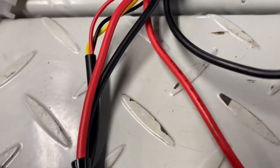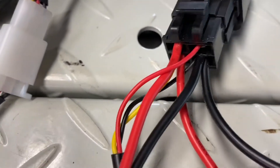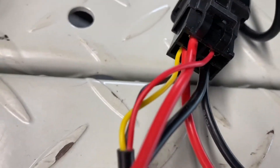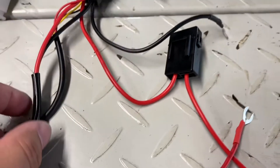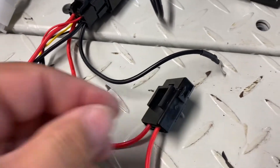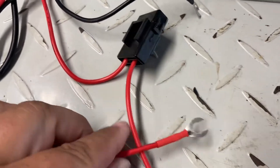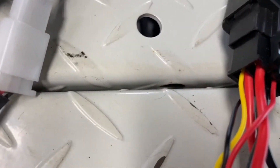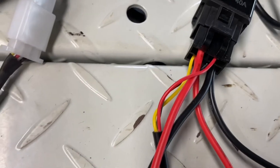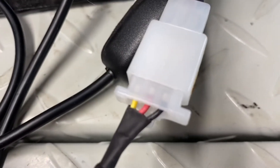Number 30 is the bottom left, which you can see has a yellow wire connected to that red wire. This is actually your main power wire. It comes with an inline fuse to protect the circuit, which you will be connecting right to your 12-volt battery. That yellow wire is actually the 12-volt power feed in — power in — that goes to that switch.